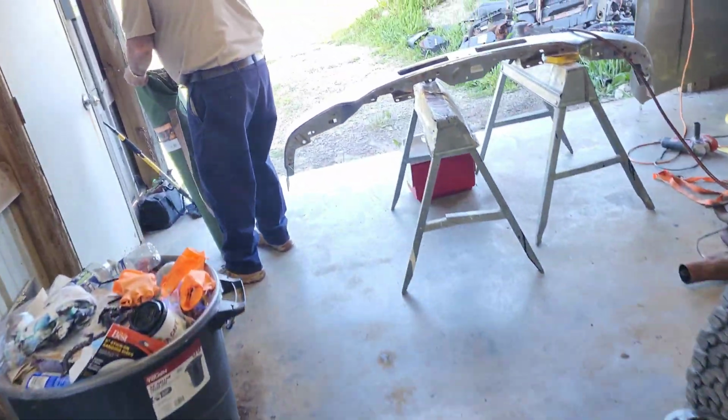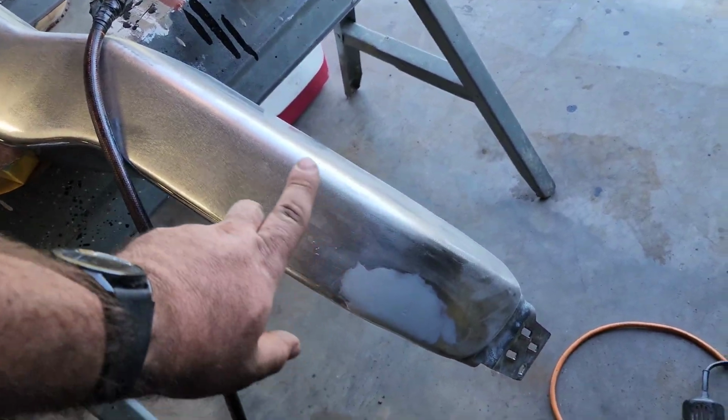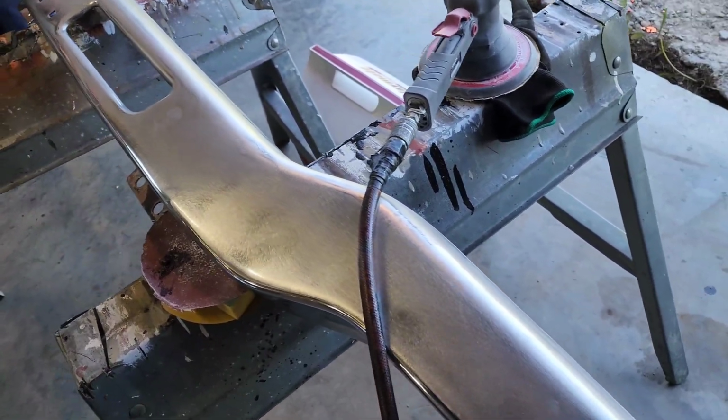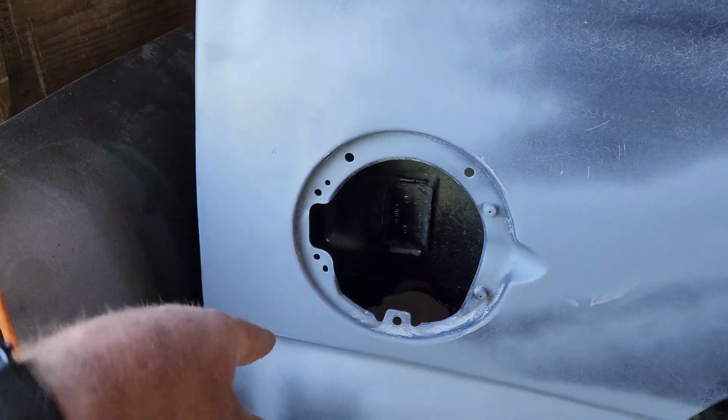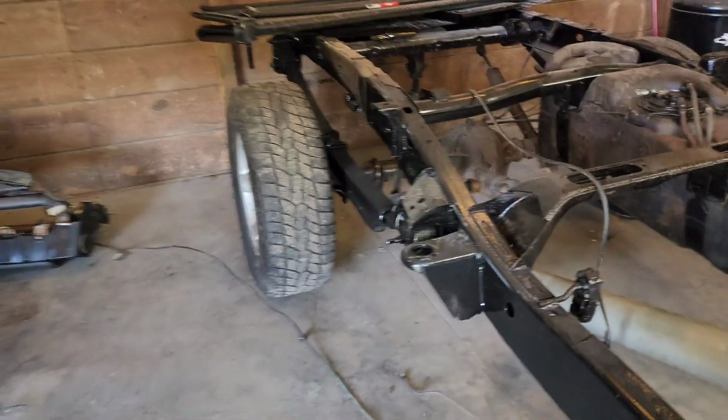Oh, we sanded on the bumper here, getting it squared away, that spot that we had to patch. Getting that all taken care of because this bumper is going to get painted. So we're busting all the chrome off of it. Put some primer here on the bedwork earlier. This does look really good. It's just got a little spot here that needs filled in either by Bondo or that filler primer stuff. And then over here, this looks amazing until you put a light on it. A lot of deep cuts from sanding and being impatient. That's my fault. I did that.